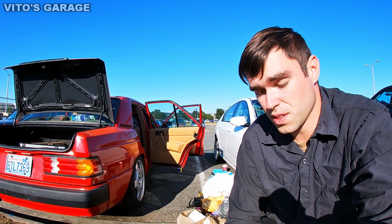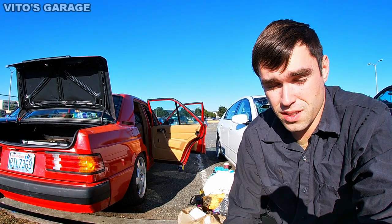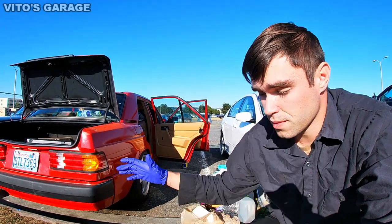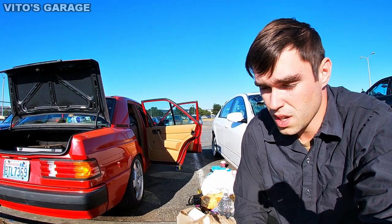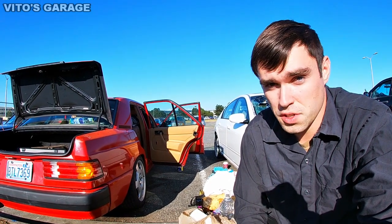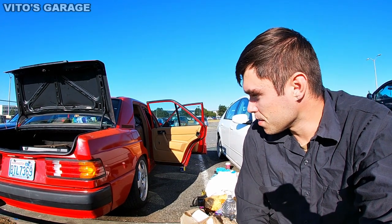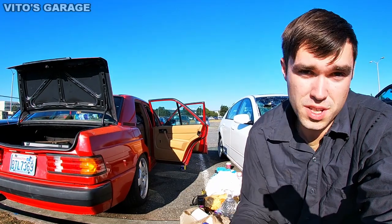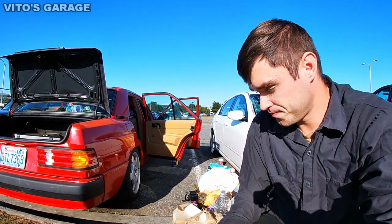And of course we're gonna do the preservation at the end with my favorite undercoating method, which is a wheel bearing grease. We're gonna grease everything up to make sure that the area is well preserved and it will never rust anymore. It's just the best undercoating that you can do for your car and save your car from rusting, which is grease. Okay, so that's the plan. A lot of stuff, I'm gonna get going. I don't know how much I'm gonna film, but just enjoy the video.